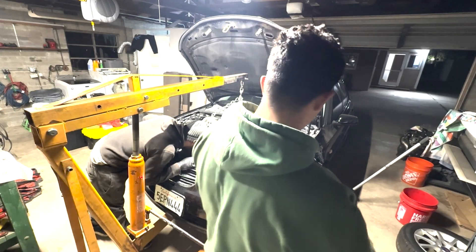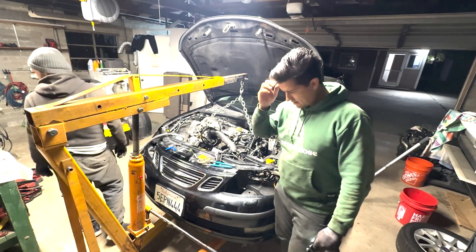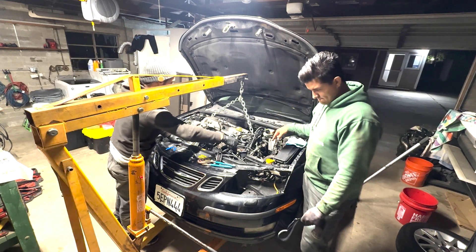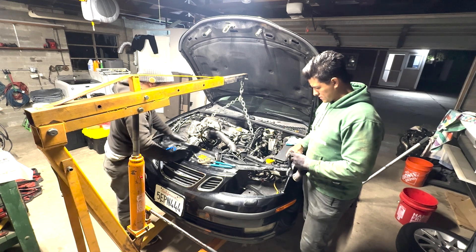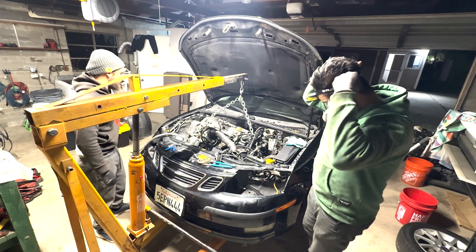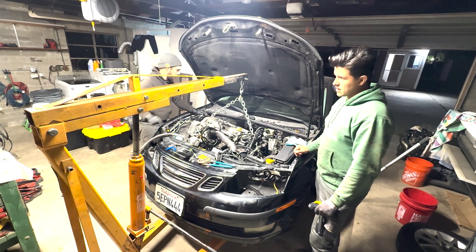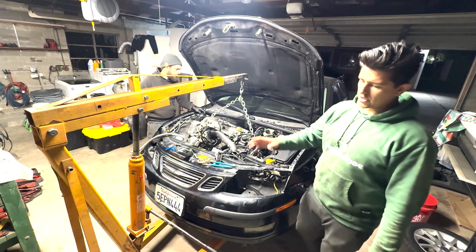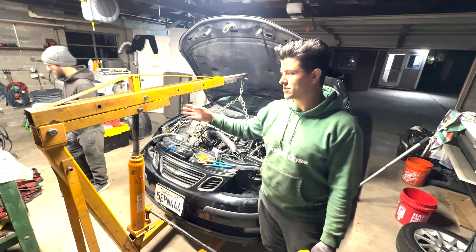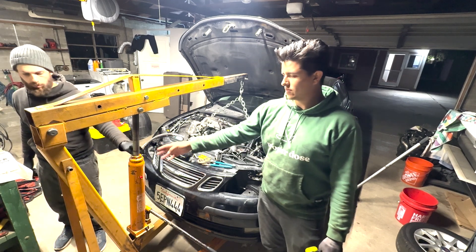We're a little held up still, but almost there. Need a couple more things — I think we're held up on the transmission mount on that side, or motor mount, tranny mount. There's one wire right here that appears to be a ground, that's really it. We're also considering pulling the AC compressor to get a little more room so we can go straight up without having to remove that bracket. We're in a unique situation — our new hoist, which we got for $100, required another couple hours of labor to actually work. I had to pull this part and rebuild the whole cylinder.